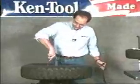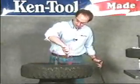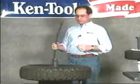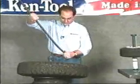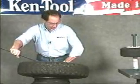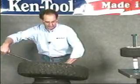To mount the same tire on the rim, we want to first lubricate both beads of the tire. We can do this while it's sitting on the rim. And again, using the curved end of the tire snake, we want to first start by cocking the tire towards us and inserting the curved end of the tire snake against the rim. Keeping the palm of your hand on the sidewall of the tire to hold it in place, pull the tool in a clockwise fashion.